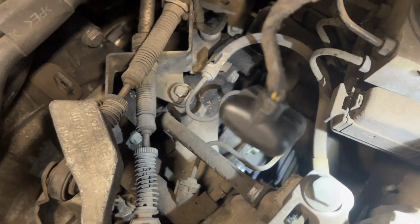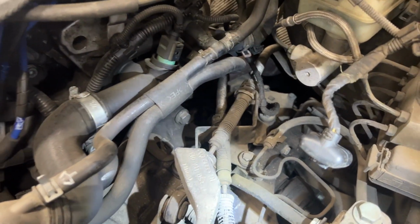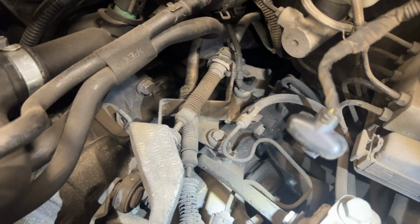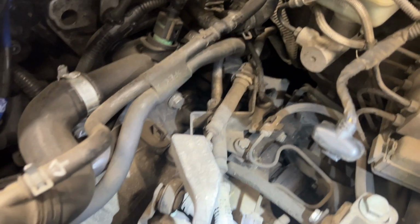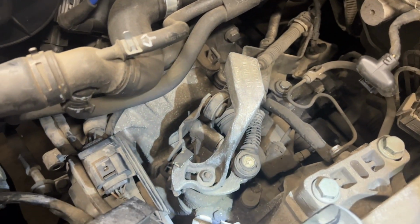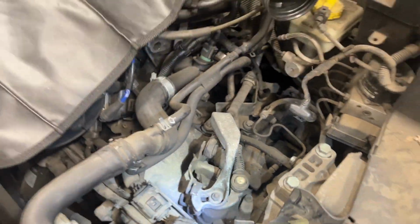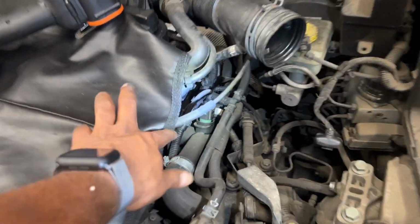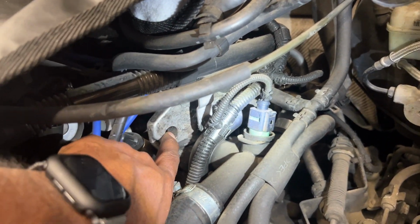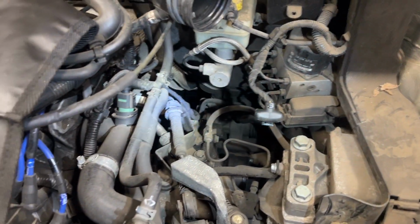There's the axle. I'm gonna remove both front wheels, but disconnect the axles on the transmission side and just push them aside. I'm not gonna remove them completely. And a few more things and should be ready to drop the transmission. I'm gonna use the engine support bar to secure it. And here is the support hook. You place a hook into this and then use the support bar. That way, when I disconnect the mount, the support bar will take the weight.